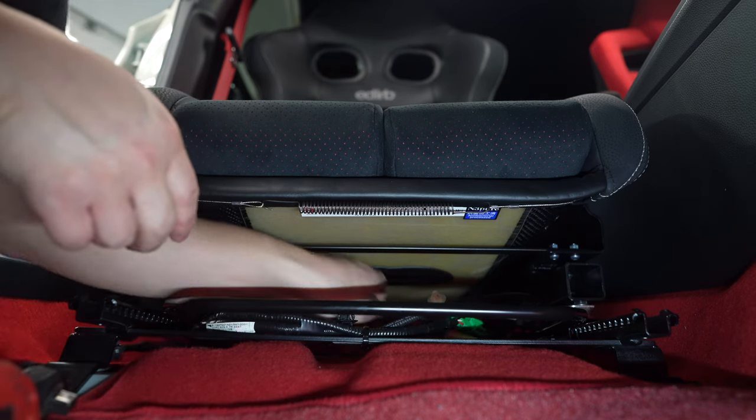The driver's side should be easier because we only have one sensor. When they're brand new, they're hard to slide. Just make sure everything is not catching — which it's not. All right, we're good to go. So I took the bolts out for the driver's side. Now we're going to go ahead and unplug the seatbelt again — which is blue — and then the seat position sensor, which is white. Let's do the airbag first — airbag's always yellow. And it's out.